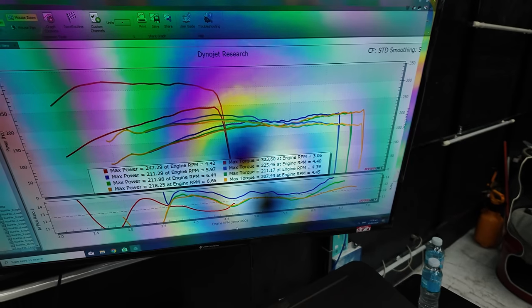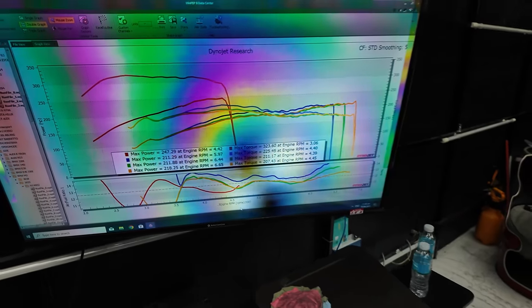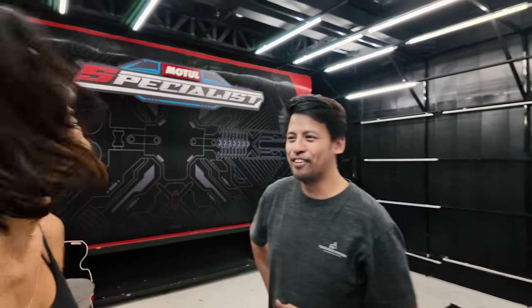And if we're losing crank signal, it basically affects everything. Crank signal is in charge of timing and everything, and fueling. Everything revolves around the crank. So, okay, abort. Change car.